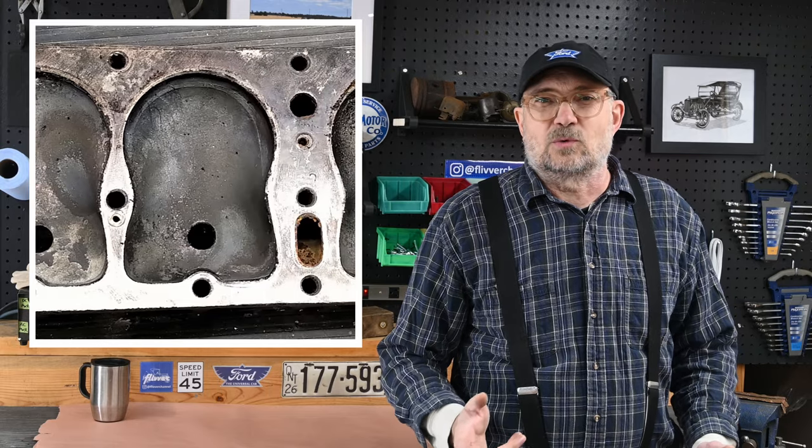At least two new valves were in order. But since I had it all apart, I decided to rework the valve seats, replace all the valves, keepers, and springs. Bead blasting made quick work of the carbon on the head, and a few hours of scraping and scotch-brite cleaned up the pistons and the deck of the block. The head wasn't absolutely flat, so I had a local engine shop plane it — just a minimum amount.